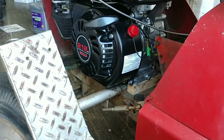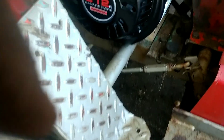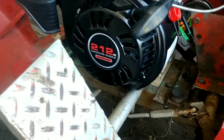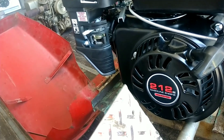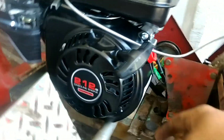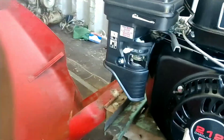Don't forget these little Predator motors come with zero gasoline and zero oil. I added half a quart of Super-S TMS 15W-40 — just a regular diesel engine oil. I run diesel engine oil on most of my small engines; a lot of new oil doesn't have much zinc, but diesel oil still does, and air-cooled engines love zinc. I've had good luck with it on a Scag with a thousand hours and a 23.5 horsepower Kawasaki. First-time start: fuel in, oil in, ignition on, gas on, choke applied, throttle all the way down to turtle — let's see if she fires for the first time since leaving the factory in China.